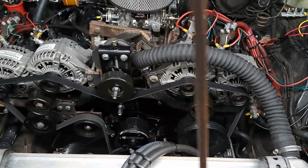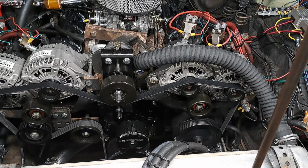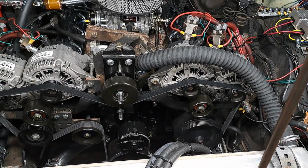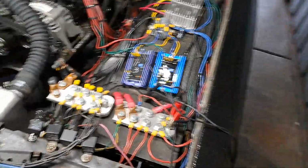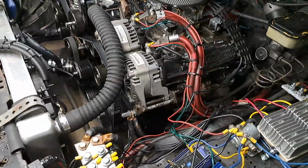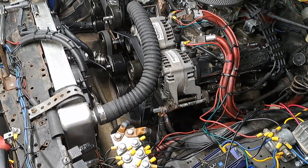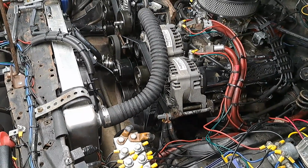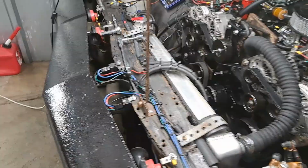But I saw it yesterday. The highest it got was like 167. And that's good to me. I don't want it getting scalding hot up under here, man. I want everything to run cool. So that Meziere water pump is moving 42 gallons per minute. That's the heavy duty one. Everything is good. So it's working out, people. Okay, it's working out, man.